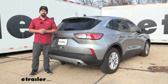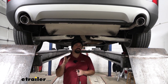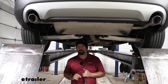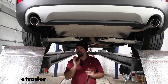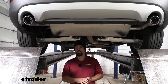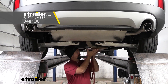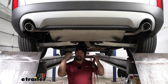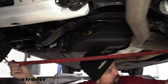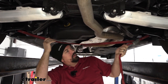We're going to begin the installation by lowering down the exhaust. That's going to give us more clearance to get the hitch up in place, and the exhaust bracket locations might cause issues getting the hitch in. Before we drop it, we want to support the exhaust — if you're in your driveway or garage, put something under it like a block of wood. I'm going to find two points in my suspension to create a cradle so the exhaust is supported when it lowers down.